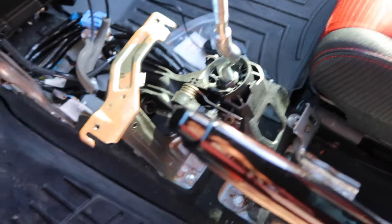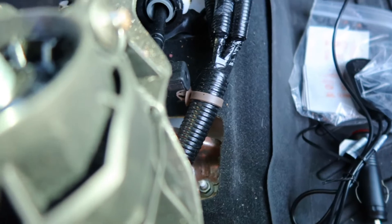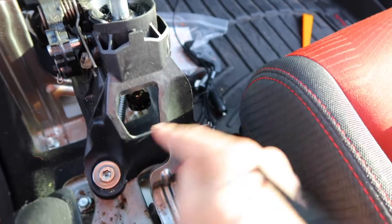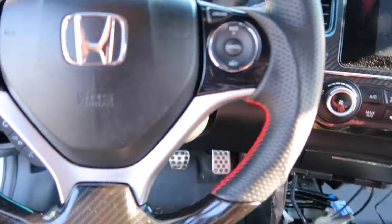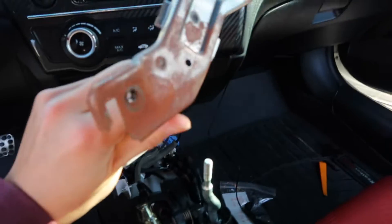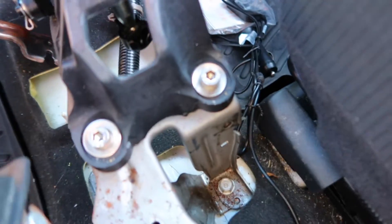Let's remove this Buddy Club shifter. From the instructions, the next step is removing this metal bracket — two 10mm bolts here, and then this bracket too, with the bolt on the other side. I think after that we can remove the shifter with what looks like a Torx key. So far no problems, which is surprising. Now that I said that, we're probably gonna run into some. Honda Gods, please don't do this to me. Got the two brackets out from here and over here — the shifter's next.